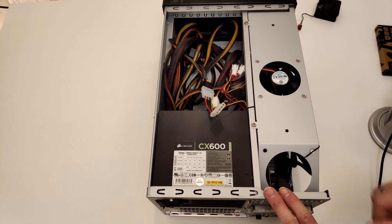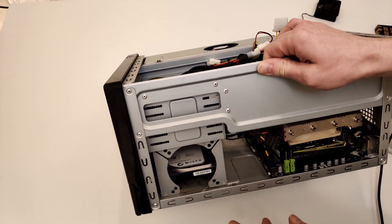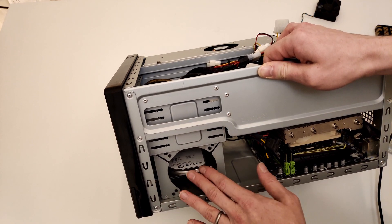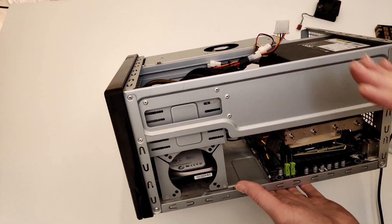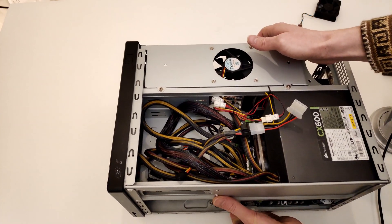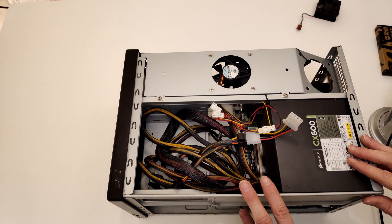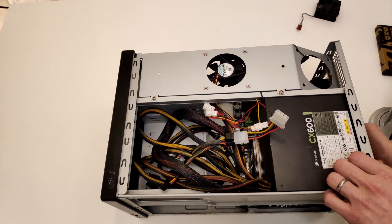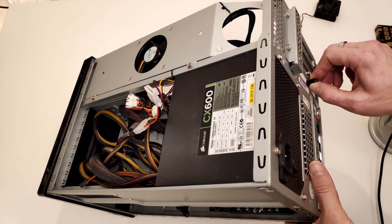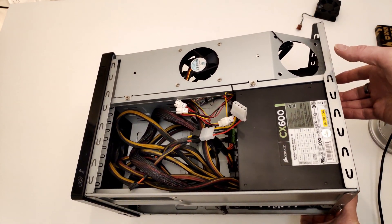To avoid CPU overheating I had to mount this fan on top over here. Originally the fan was mounted here to cool down hard drives and SSDs, but this hard drive does not require extra cooling and the SSD is installed on the motherboard. Unfortunately this is an old fan with a 3-pin connector and if I connect it straight to the motherboard it runs at full speed, which is very noisy. That's why I had to add this extra fan speed controller, which you can see over here — this little thing can regulate the speed of the fan, which makes it much better.